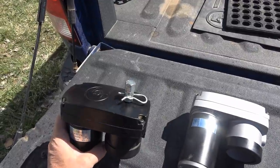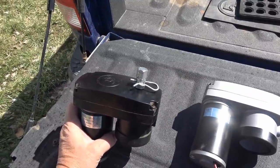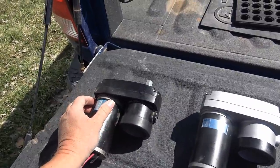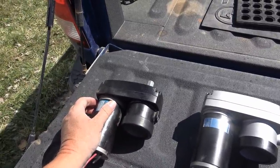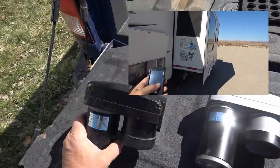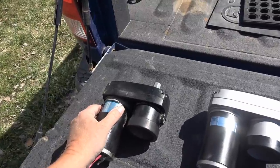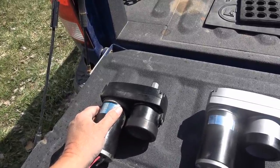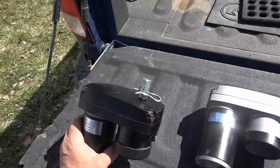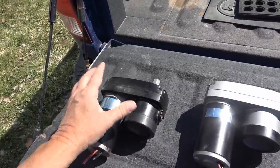At the time I was able to locate a replacement gear — the replacement was metal, so I figured that's gonna be good. The slide worked okay, but I noticed one difference: before, when it hit the end of its travel it would make a click-click-click ratcheting sound, but on the other end it would just make a quick grinding sound. I lived with it, and eventually it went back to the same problem where it wouldn't move the slide — that metal gear wore out as well.